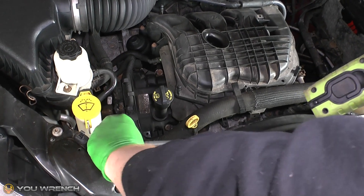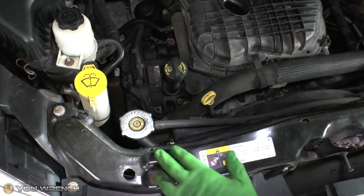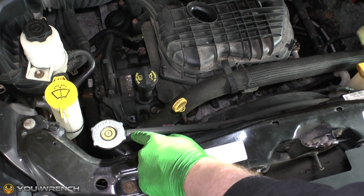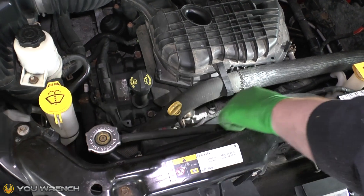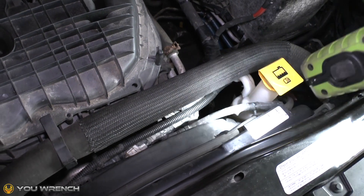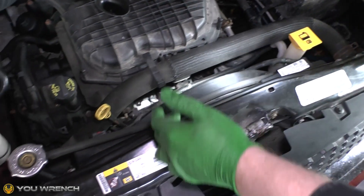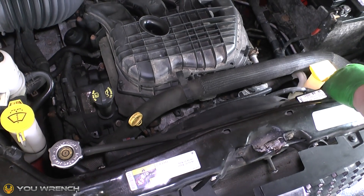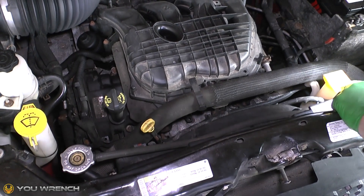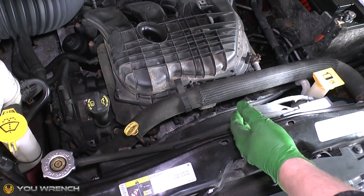The caps are actually spring-loaded — there's a little spring on it. When pressure gets above 16 psi, this will actually open inside and allow the excess pressure, usually in the form of air, to flow down into the very bottom of this tank. It comes up as bubbles through a little overflow. When the engine cools down, it will actually suck coolant back in, so the level is always kept constant. You'll see that when the engine is very hot and running, the level might be quite high in the reservoir, then you check it the next morning when it's cold and it's gone right down again.